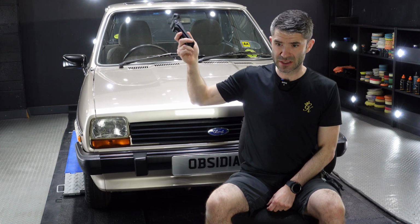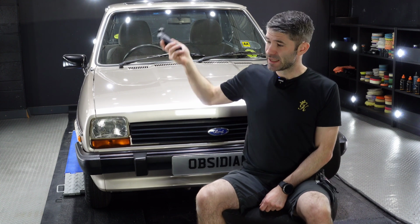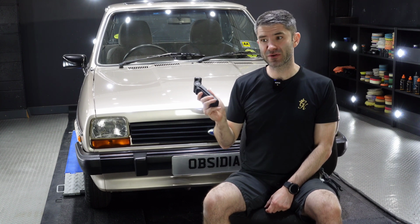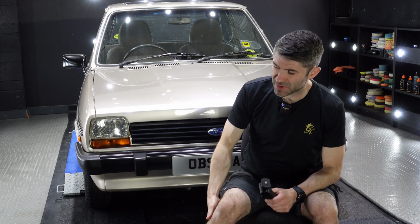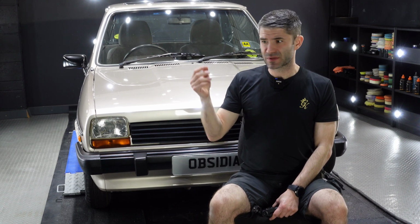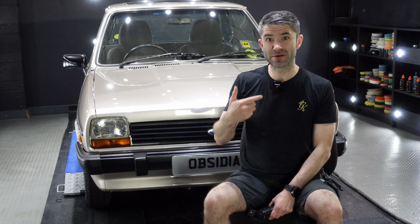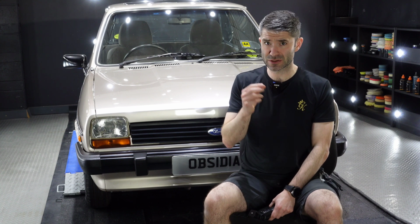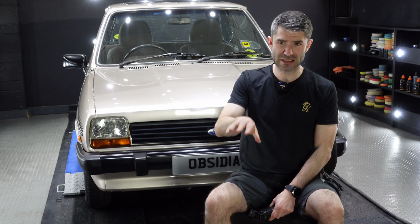Front lights are fine, rear lights will need polishing, because they're a little bit swirly. And then ideally I'm going to get underneath. Although the whole thing has been wax oiled or undersealed, whatever system they've used, there is still some bare metal underneath, exhaust, back boxes, that kind of stuff. I would like to treat those with some Atomac from Bilt Hamber, and then get the owner to buy some and continue using that, because I think products like that on vehicles like this are completely invaluable.